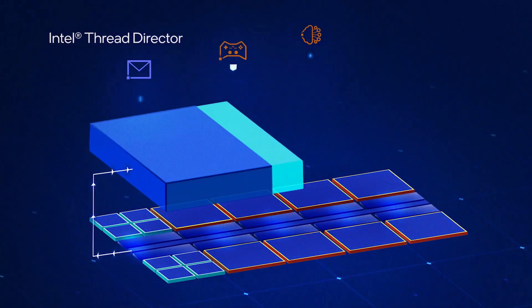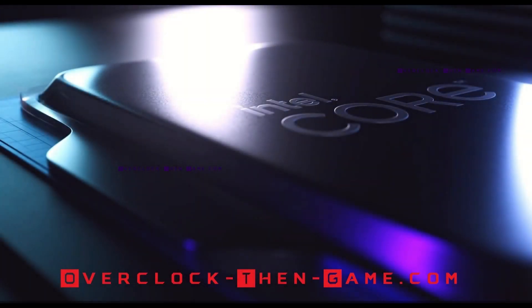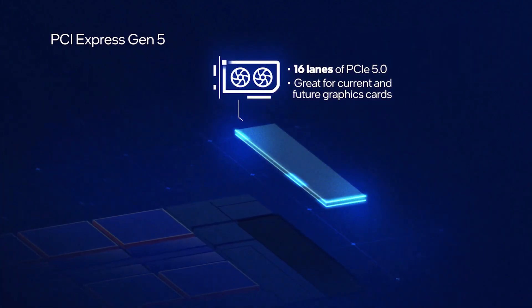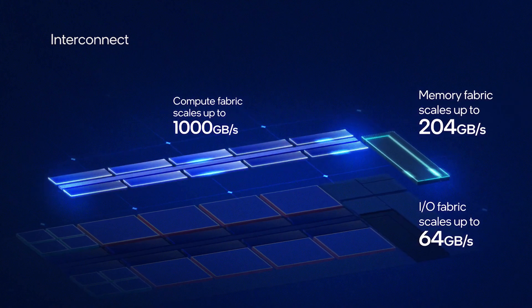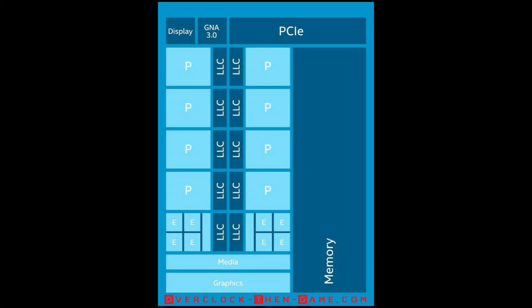My ultimate goal was to undervolt, lower wattage and temperatures, while keeping the same stock performance or near stock performance. I went from a CPU vCore setting of 1.27 to only using 1.11. I overclocked the eCores to 4GHz while overclocking the DDR5 RAM to 5600MHz. The performance cores are running fine without underclocking. My CPU package wattage decreased from 224 watts stock to only 184 watts on average. The wattage from the wall outlet decreased from 368 watts to only 275 watts on average — a drop of 93 watts while increasing performance. I decided to take another deep dive to show actual performance increases at many different levels within the microarchitecture, rather than simply running typical synthetic benchmarks, and to show the same type of deep dive as I did in my initial Alder Lake S video.